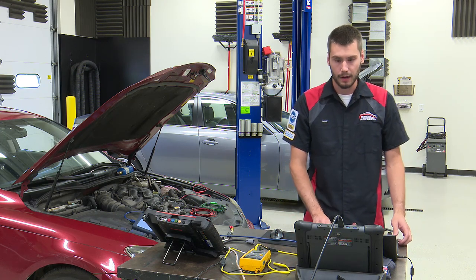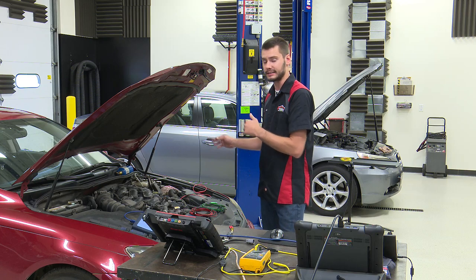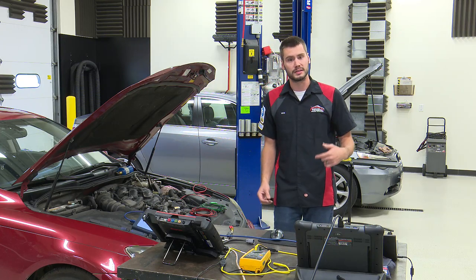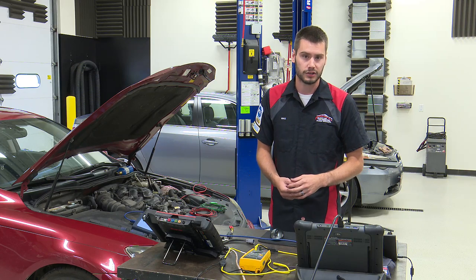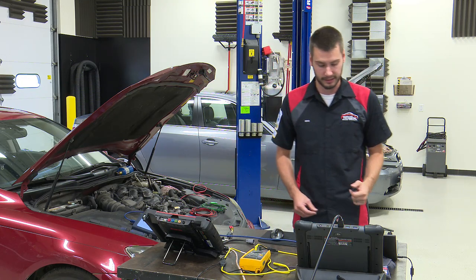We covered this slide last week — basically calling out what a wideband sensor is. It monitors a wider range than a standard O2 sensor. A normal oxygen sensor only reads 14.7:1 stoichiometric. Our air fuel ratio or linear UEGO wideband sensor reads significantly richer and leaner, telling the PCM exactly where the engine is at. It's post-combustion fuel control — exhaust gases flow through, the sensor picks them up and determines oxygen excess or deficit.